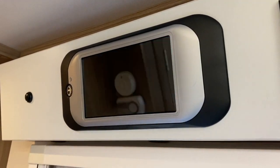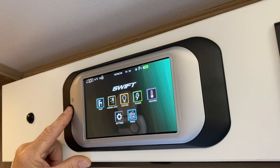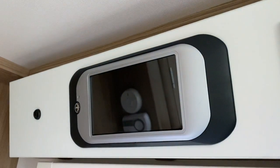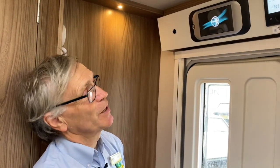This will go into sleep mode after five minutes. When you're towing, to actually turn it off, you do need to hold the button for about five to ten seconds and it'll turn off. That's all your 12V off. To start it up when you get to your campsite, just press the button and up it comes.